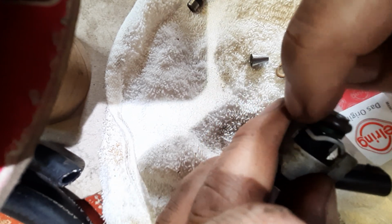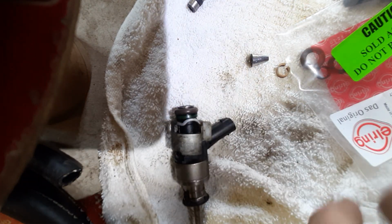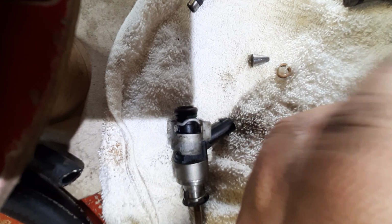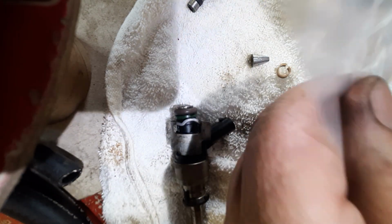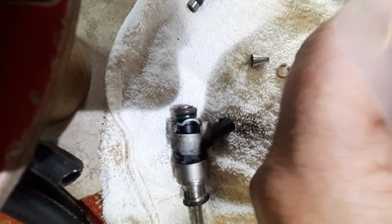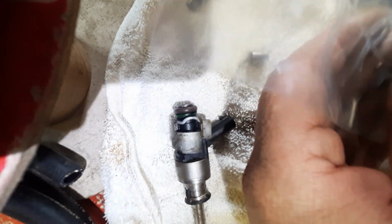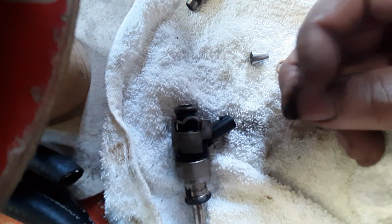The lube goes on the very outer edge. Never, ever in such a way that it could actually get into the injector, because then you're screwed. But on the outer lip, and as you press it in, it's impossible for that lube to do any damage, because it's all being pushed to the outside, not going on the inside, so you're fine. I mean, even if it gets into the injector, you can clean the injector, but it's a pain in the butt.